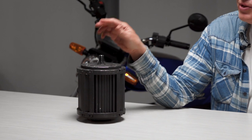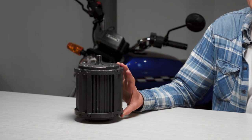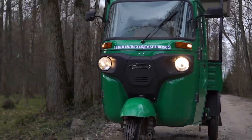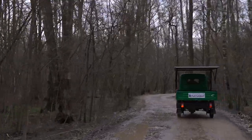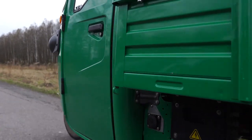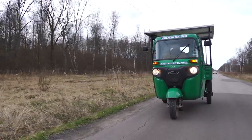What interesting things have happened in the last year? When we prepared a kit for India for Bajaj Maximo, we saw that the motor allowed to develop a speed up to 20 km per hour, just using solar panels with a capacity of 600 Watt. And this kit, if you put solar panels on it, allows you not to use the plug at all, and rather to be charged from the sun. Even with our Moscow region sun, I never used a plug — the battery was always full. I covered 50–75 km per day, and the battery was always charging.